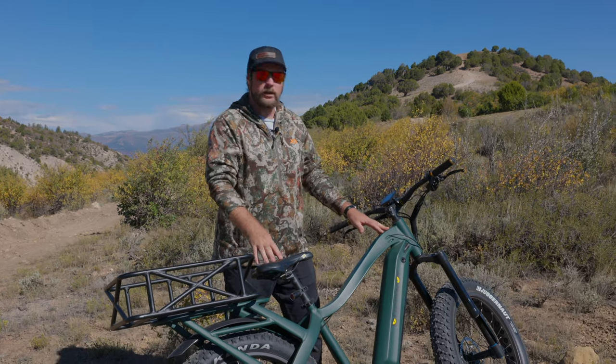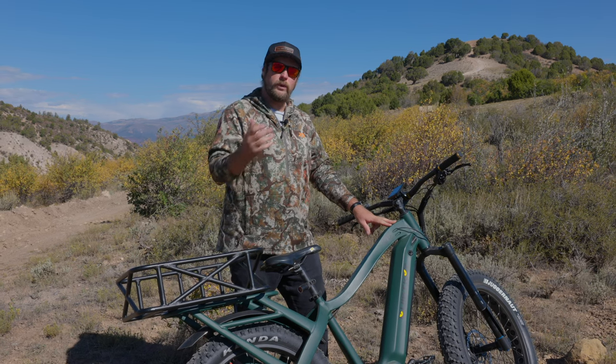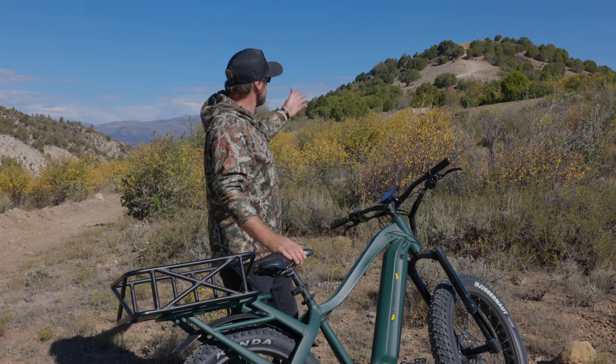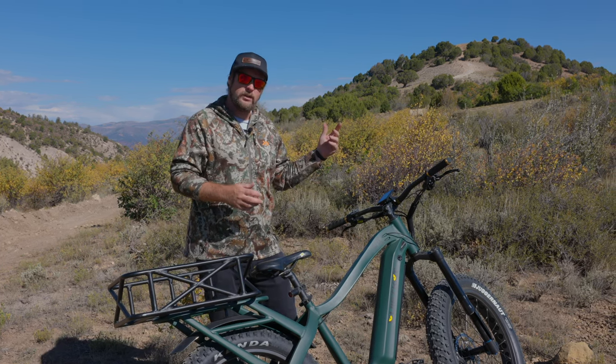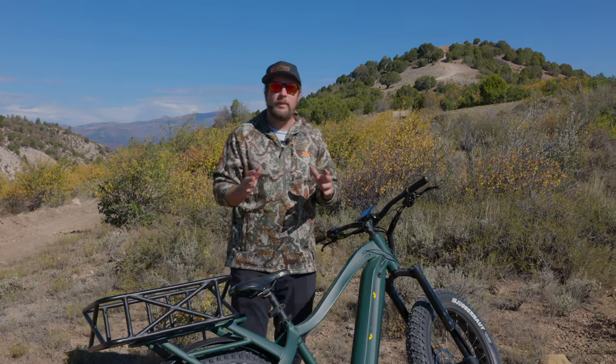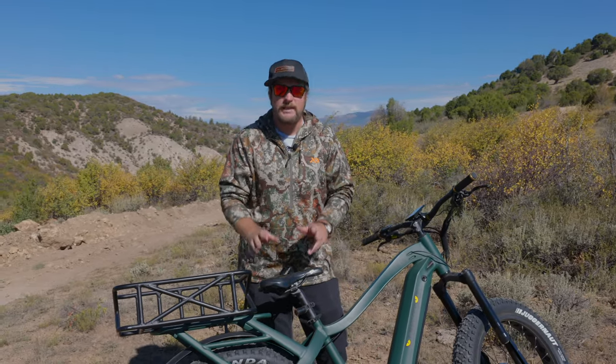On my Apex here, I prefer power level 3 in eco mode — it has enough power for me to move with the machine and all of my gear over most terrain. When I see a steep hill like this, I'll go up into level 4. And for the steepest hills, I'll switch over to sport mode and give her all she's got. One thing to remember is that you can have all the power in the world, but you need to have grip. So it's important to make sure that you're maintaining grip on the rear wheel — just enough power to overcome the terrain that you're riding. Those are just some of the basics on riding, shifting, and braking on an electric mountain bike. Thanks for joining us today. We'll see you out on the trail.